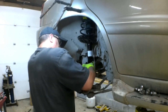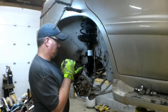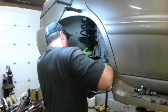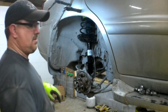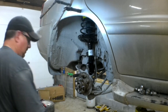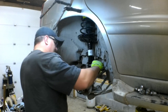I work by myself so I've got to come up with a way to do it on my own. What I ended up doing was getting a very large pair of oversized channel locks, and as I pried it up I would use the channel locks to pull the strut into the knuckle. It took a little bit of work but eventually I got it close enough to where I could stick a screwdriver — or maybe it was a ladyfinger, some sort of prying device, because we all know screwdrivers are also pry bars — into one of the holes. Once you get one of the holes lined up you're golden; just wiggle it around and the other one will line up. I think I started with the bottom hole first, and once you get the bottom hole lined up just push in on the top and the top hole will line up. This was literally the hardest part of the whole job — just trying to get that new strut back in place and lined up.